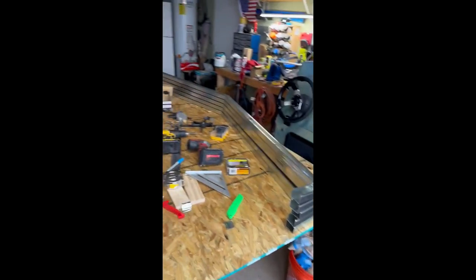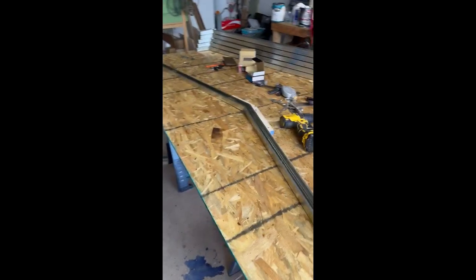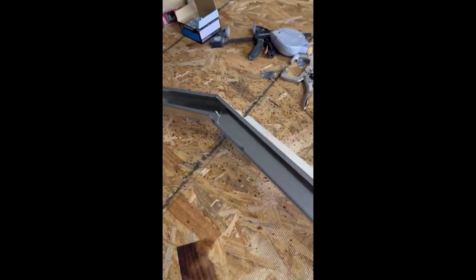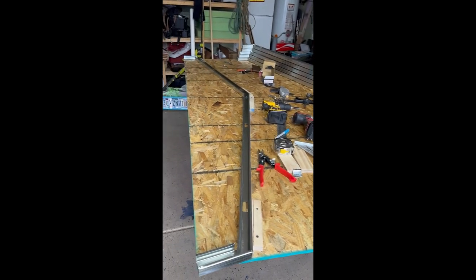Probably the next video will be me assembling everything — not really set up to make a video today, but check it out. These are metal studs that I'm bending to the shape I want. They're going to get a cap all along here — the track — and then an aluminum angle, and that's what the legs are going to mount to. I made a little jig here just to make sure everything lines up right. I have to make nine of these because my roof is going to be 15 feet long, which is probably the longest roof I've seen, at least the hard lids.